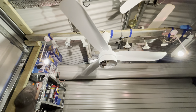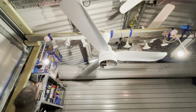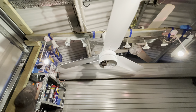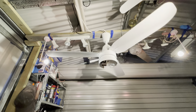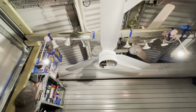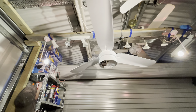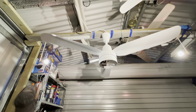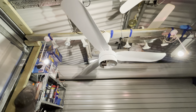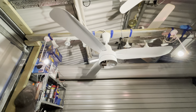By the way, all of these fans I'm going to be testing them as-is. Also, these Mistrals are only 60 watt, not 65. The MCFLA 48 Style 3 that I've had forever — it was like the first fan I ever got in my collection — had 65 watts. These are 60 watts. They have a 1 microfarad capacitor; the other one has a 1.75 microfarad run capacitor.